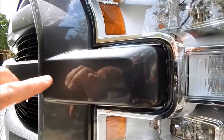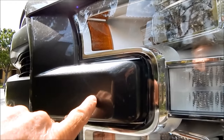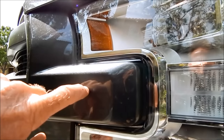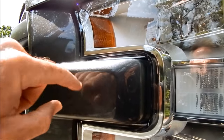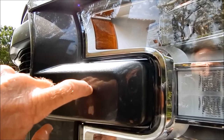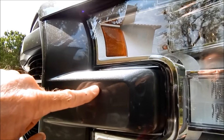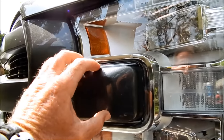Let's have a look at the two scratches I'll be dealing with. The first starting point is what most detailers call the fingernail test. If I go against the grain of the scratch, can I catch an edge with my fingernail? In this case, I can catch a slight edge — and trust me, because clear coat is so thin, this matters enormously.